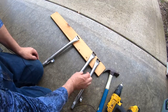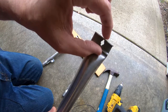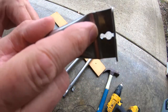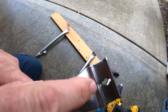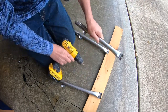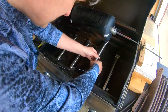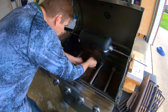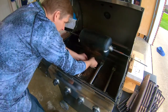It looks like on these, that hole right there is a little short in distance on these. So what I did is drill the hole to extend it, because I needed more length on this to fit over the existing hole — punch right there to fit the drill bit in and then drill it out. And there we go, this just needed to be a little bit bigger. Now that the hole's bigger, this fits on the other metal piece a lot better. So sometimes you have to make some modifications.